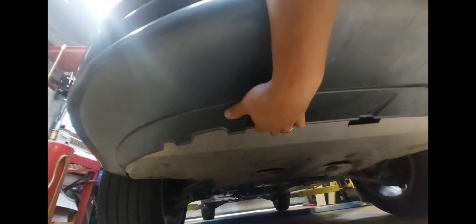Basically what you need to do is from the fender liner there are some Torx bolts that you need to take off. Then, depending on the model, there are usually bolts that come from inside the fender. You need to get from behind the wheel liner and get those nuts off. Then you have to remove the belly pan shield. This one's got a big aluminum one, but most of them are plastic. The bumper cover is also attached to the belly shield, so you'll have to remove that before you can remove the bumper cover.